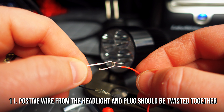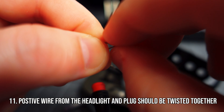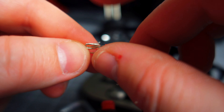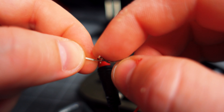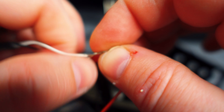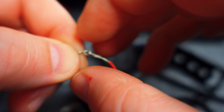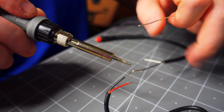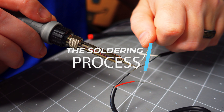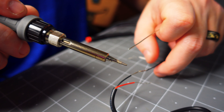What you do is hook those two together and kind of squeeze the cables together — get them nice and flush, as flat as possible. Then just twist them, kind of wrap them around each other. Basically we're just securing them so when we go in and solder, the cables hold together and you don't have to worry about them coming apart. The cable is pretty thick so it'll hold up pretty good — you don't need any alligator clips or anything like that. Just set them down.